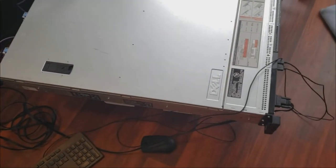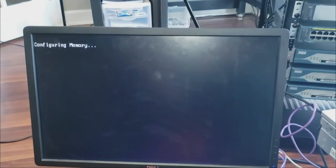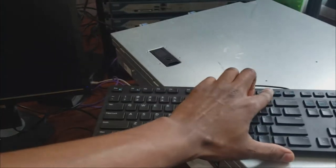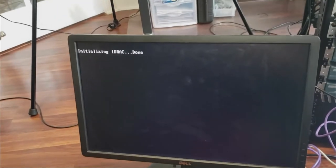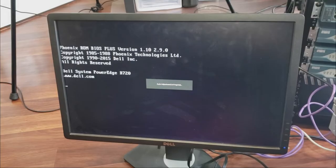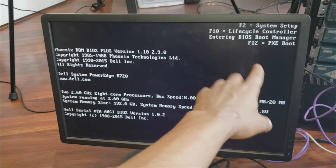So I just turned it on using iDRAC and you can see stuff coming up on the device. It's going to get noisy on initial setup, keep that in mind. I'm going to start pressing F11 to get into the BIOS setup before it boots. On a server, unlike a desktop, you can just hold down F11 rather than pressing it over and over.